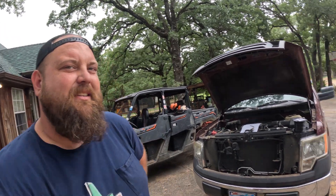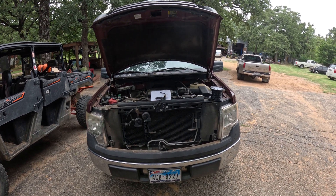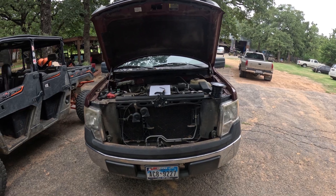Do I have a doozy for you today. So here sits a 2009 F-150 — this is my neighbor's, and it has been a roller coaster of a ride. It had the known ABS issue where the module wires broke loose inside — a B1342 code. Module wasn't communicating. Couldn't talk to it. Pulled the module out, sent it to a repair place, the repair place completely botched it. Now the module is toast. Hopefully this legwork can help someone out.